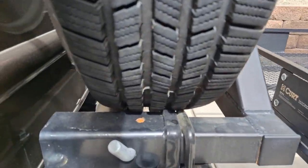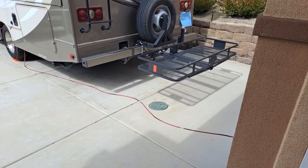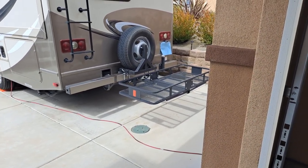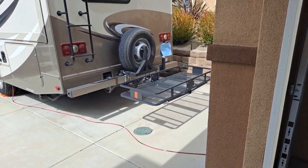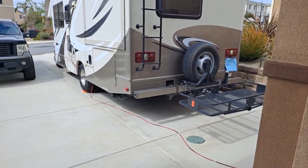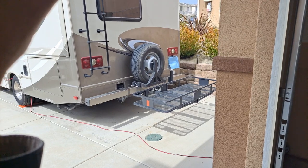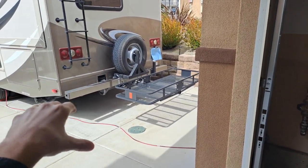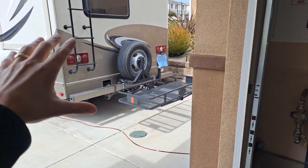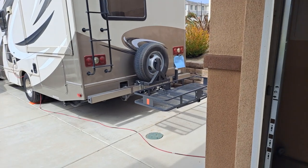The point of the round plate is so it can bolt onto the holes on the rim. The main thing about this idea is that the tire is sitting on the bumper, so the weight isn't actually being held by the mount — the bumper is holding it up. The reason I liked this idea is the concept of holding 50 pounds on your shoulders versus in your arms sticking straight out: it's a whole lot harder holding it straight out. A lot of mounts attach to the bumper and the weight sticks out, creating a turning force — a moment — and that's what strains the bumper and makes it want to twist. With this setup, the tire sits on the bumper all the way, and the mount is secured to the bumper but its main job is just to hold it in place so it doesn't fall out.